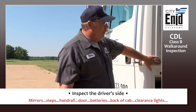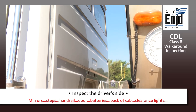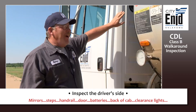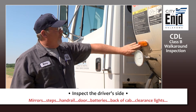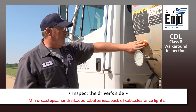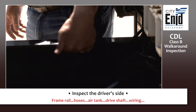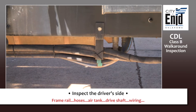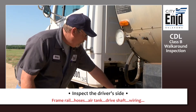Move to the back of your cab. Check the back to make sure it's not rusted and there are no leaks. Check your back window — make sure it's not cracked and clean so you can see through it. Check your clearance lights: clearance lights are amber on the sides, red to the rear. Check your frame rail — not cracked, broken, or illegally welded. Check your hoses that come back through here: not cracked, not leaking, no excessive wear.